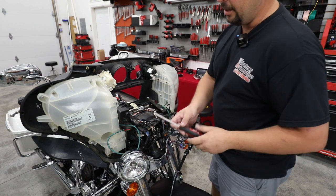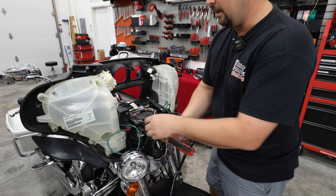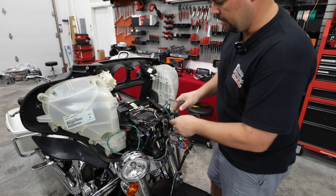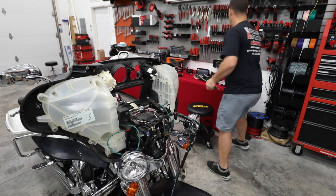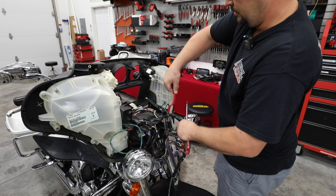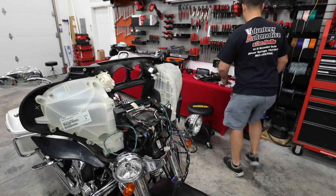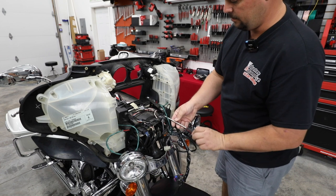While you've got your radio out, there are two plastic push clips that we can take a Phillips screwdriver and get these clips undone. They're just plastic. We're going to push those out, two little retainers, one on each side. Let me pry this one wiring clip out. Get our second retainer undone here.